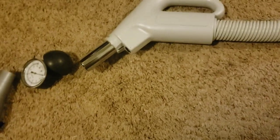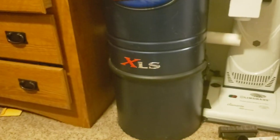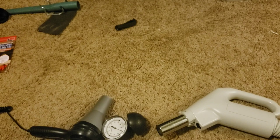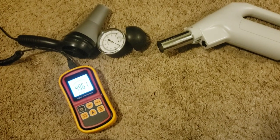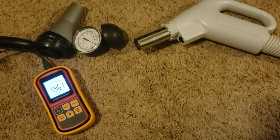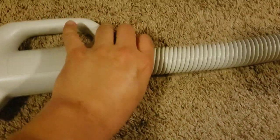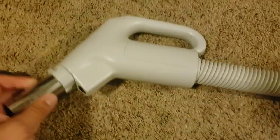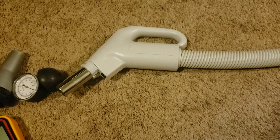Clearly it does have more airflow. The suction isn't quite as good as the Canavac, which has the single 8.4-inch motor, where this has two 5.7 two-stage motors in parallel, which is supposed to give higher airflow. But the suction probably won't be much higher than a single motor. When you add the hose, you're going to have some leakage from any of the swivel joints or the connections. Even though this valve is closed, we still experience a little leakage because it's not really well sealed. But there we go — we have a little bit more data.